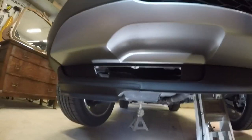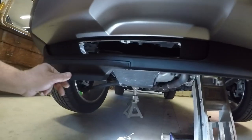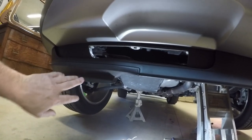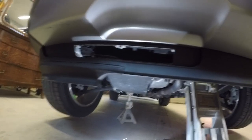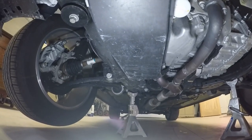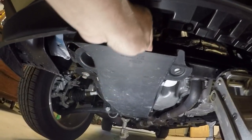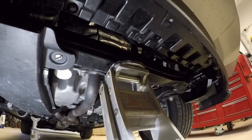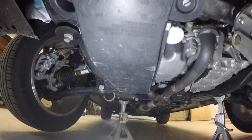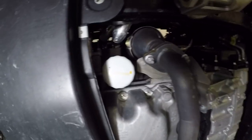When I first got the truck I was a little concerned because these hung so low, but I realized this is a more rigid plastic that's flexible, and these are actually a pliable rubber — so I thought right off the bat if I hit a curb those would snap off, but they won't, so good design there Ford. There's a hole cut out here for an air duct which runs all the way underneath, and at first I thought it was a metal part of the engine cradle, but it's rigid plastic and it'll crush, so I put my jack on the front of the engine cradle. I'll show you how to take this ductwork off to get to the oil drain plug — the oil filter is right there up front and easy to get to.